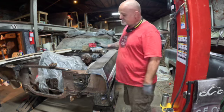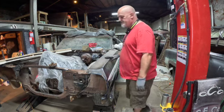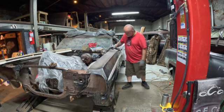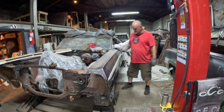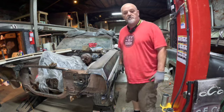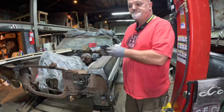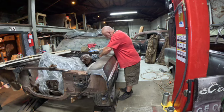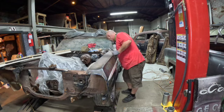I'm going to do this before I reassemble the front grill section simply because this fender skirt right here is not fastened. The whole fender is loose and I need to find out if they broke the bolt off in there — if they did, I've got to address that. Notice that the fender dropped down pretty dramatically when I take those out.